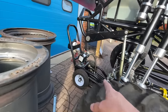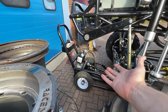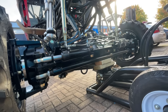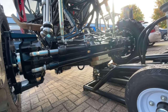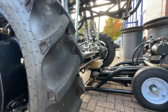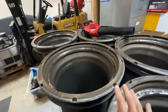While we're still busy grinding the weld down on the wheels, we're also going to try and straighten this bent bar on the back. We've put the bent section to the bottom and got the jack under it, so we jack it up and hopefully it straightens out. Keep going, more, way more — pump her up. A little bit more for luck — look at that bow. A bit straighter than it was. So the wheels are all done — next we get them shipped away, get the tires fitted, and get them painted.